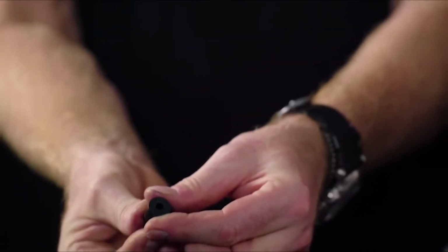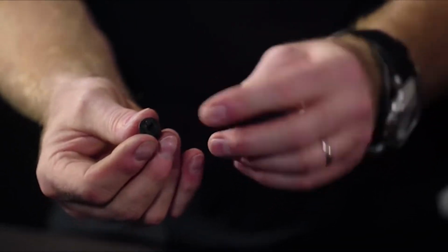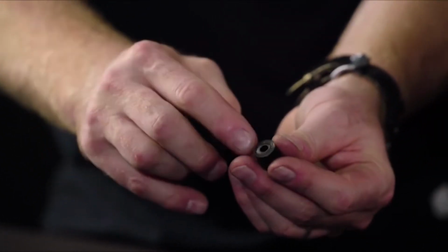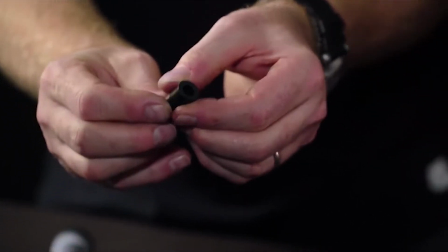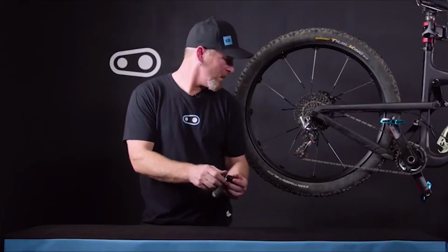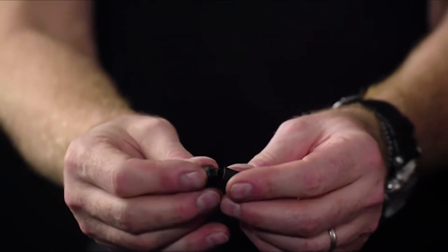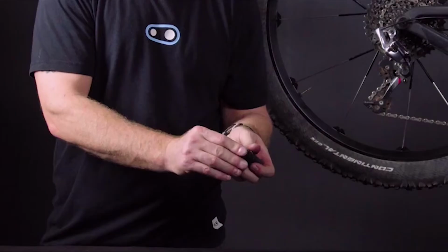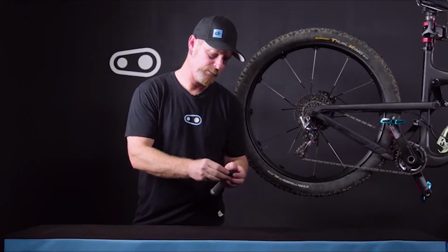and slip in this way. If you reverse those the opposite, where you have the small head fit into the small bit, you've now set it up for the Schrader valve. And just install your cap back on and you're ready to go. For this particular case, since we have a Presta valve, we'll go ahead and get it ready for that. Again, we'll go big, insert it into the pump, tighten the cap.